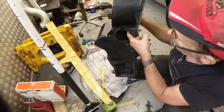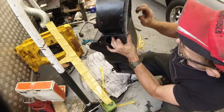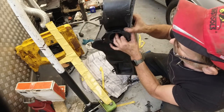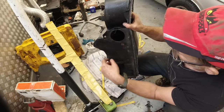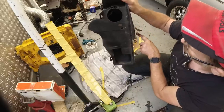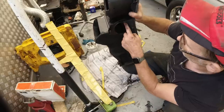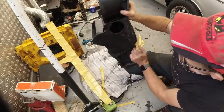moving across. What happens is, when it's in the halfway position, cold air manages to get through this divert chamber here. When it goes all the way to hot, all the air is forced through the matrix, which is installed there. So by going halfway, it allows cold air to escape this way, and half the hot air to go that way if it's halfway. If it's fully cold or off, you'll get some cold air coming out.